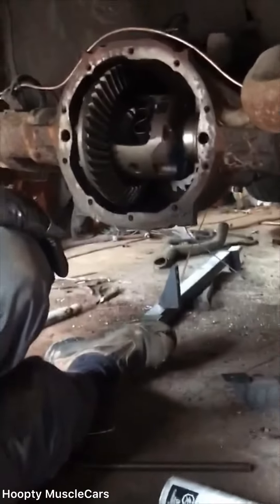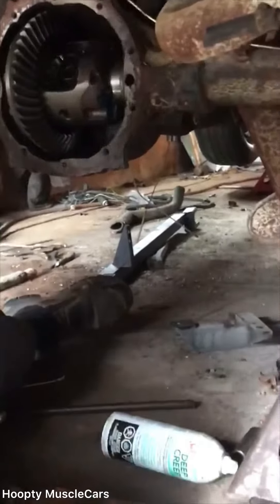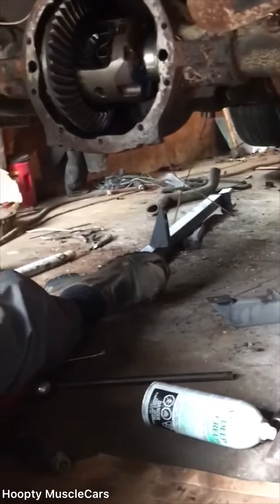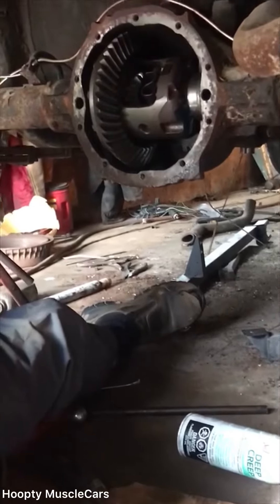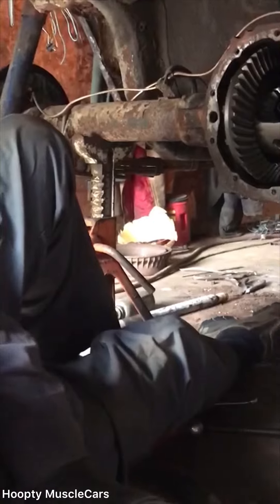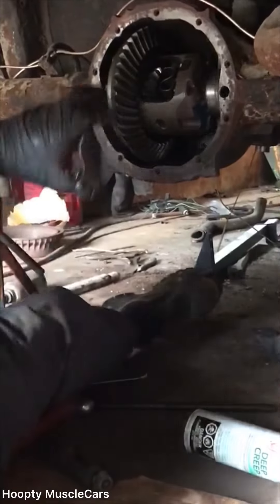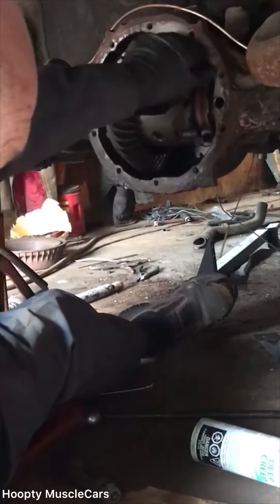If you move the carrier now you can see the clearance is good. But before it was clack clack clack, and it was probably off by about half a turn — basically the spacer's gap worth of difference.